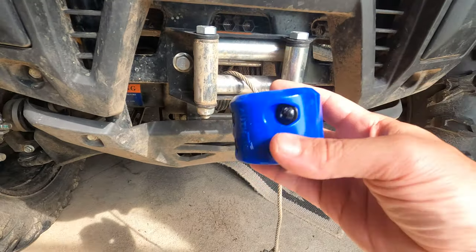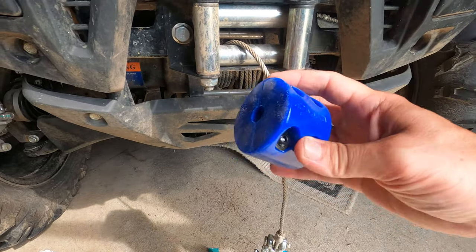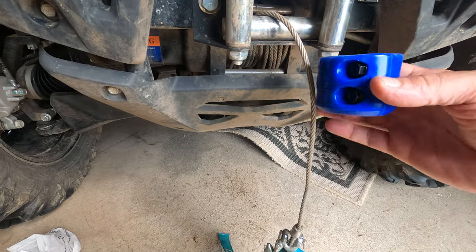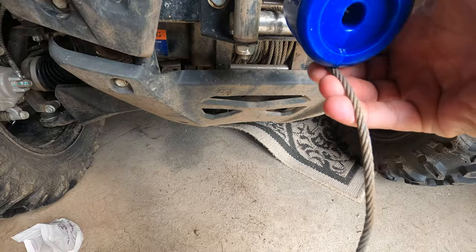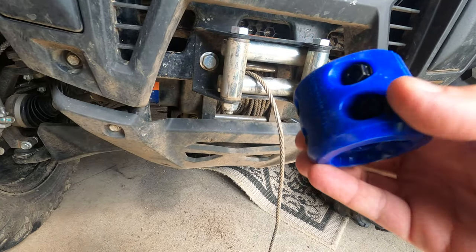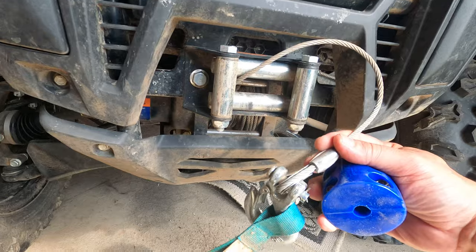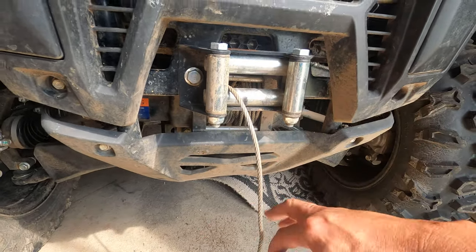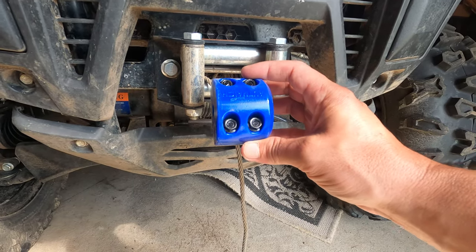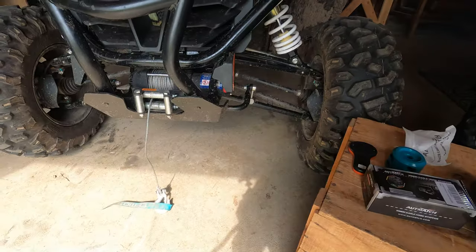The stopper is simple — you unscrew these with your Allen key, and you can see the hole. It's going to come apart in two pieces; you put it on the cable and screw it back on. Moving forward, this winch stopper is going to be in between the cable hook on the end and the fairleads, making it so when you pull it in, it's not going to go any further than this — avoiding damage to your fairleads, your cable hookups, and such. I'm going to give two of these away to one new subscriber, running the contest for about a week and a half. Hashtag subscribe to be entered.